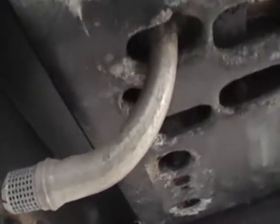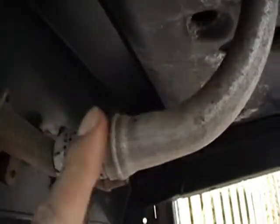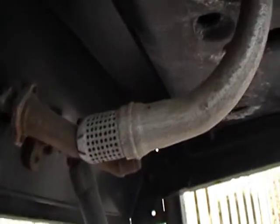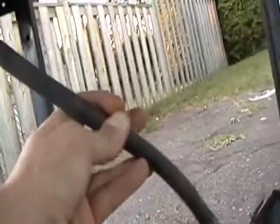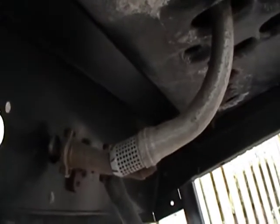The problem is that underneath, this tube leads to the gas burner. There's two. One of them was rotten and it broke off the burner up inside, so there's a hole there. If you have a problem like that, the gas will come back and it'll start on fire here. This is the regulator prior to going to the propane tank down the hose. So if you have fires here, that could be a real problem — plus it's at waist level.